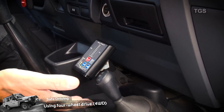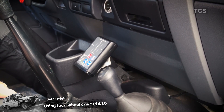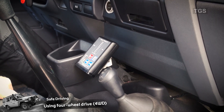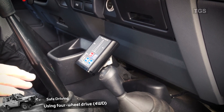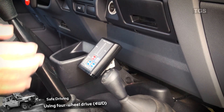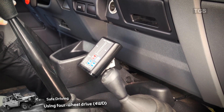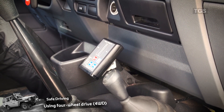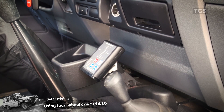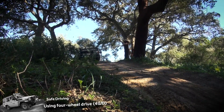When it comes to going down a hill, we're still going to use four-wheel drive in low ratio — that assists us because we're going to have maximum braking from the engine. Having a diesel engine means the engine braking will be very good, and we will not have to touch our brakes except perhaps to steady the speed a little. Normally we go down in first gear low ratio and take all our feet off the pedals — we don't touch the clutch, the brake, or the accelerator. If we touch the clutch and disconnect the engine from the transmission, the car will just slide on its own.